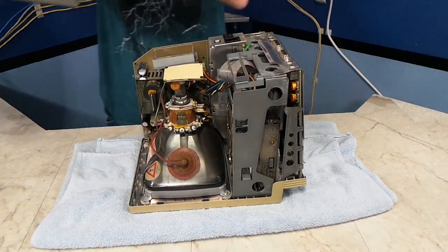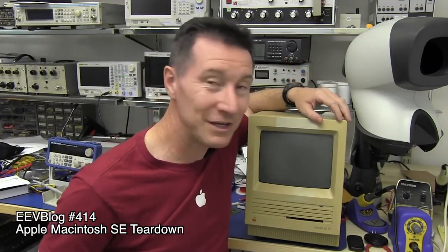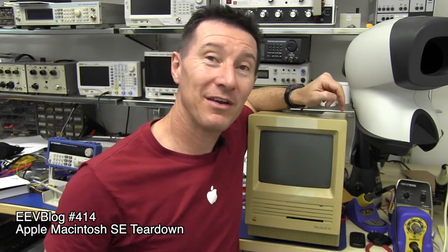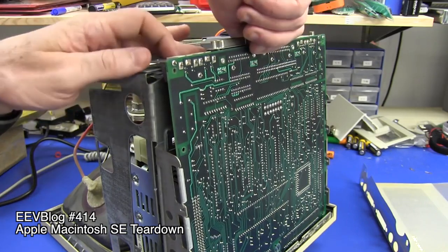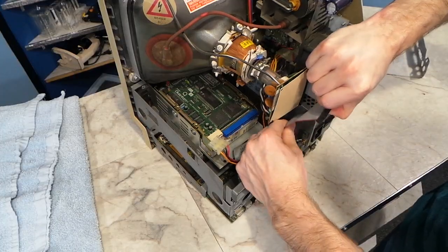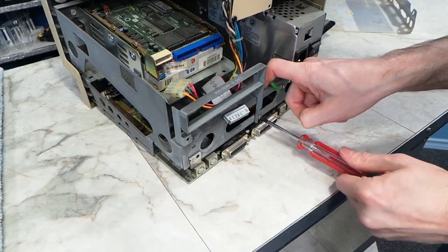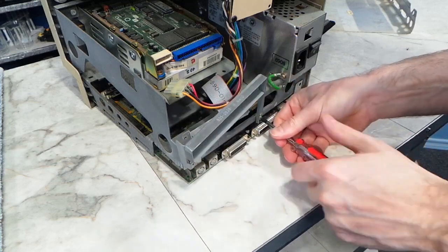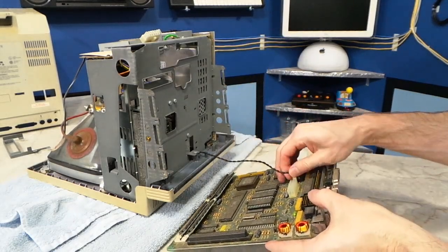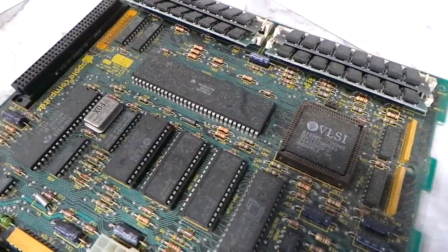Let's lift the back off and take a look at what we have to disassemble. I did watch EEVblog's disassembly of the Macintosh SE. He only took out the logic board, but I'm going to take it completely apart so that I can Retrobrite the plastics. There are some cables to unplug for the disk drive and the hard drive, however this particular cable is hard to reach. I found that if I remove the back plate first, that made it a lot easier to reach. I was going to slide out the logic board, but I realized somebody never put it in correctly — it's supposed to slide down these grooves.